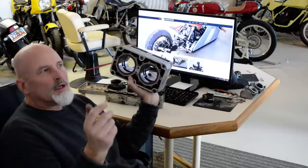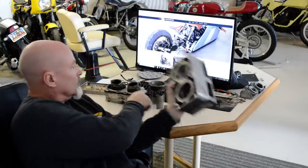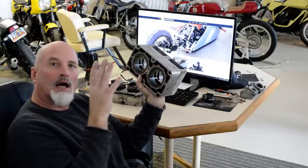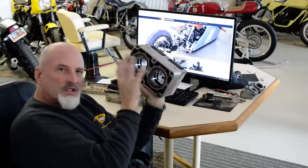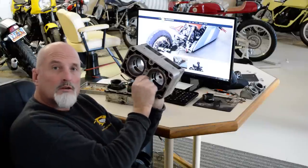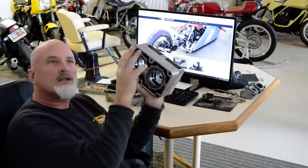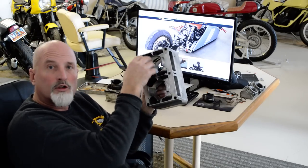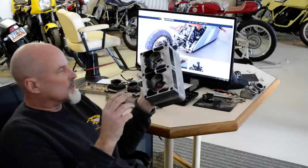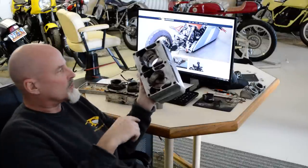Maybe this year, since I've got to remake this, I'll go back to still utilizing the coolant passages but making a really thick, fat aluminum liner with Nicosil. Same idea — but then if I ruin a sleeve or get a chip or a problem with the Nicosil liner, all I have to do is replace the sleeve. Then I get the advantage of not retaining all the heat through the transfers, which is the bad part about the iron liner. I'm not sure if I'm going to have enough time this year.